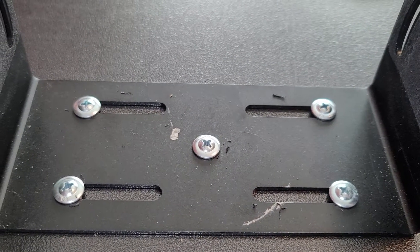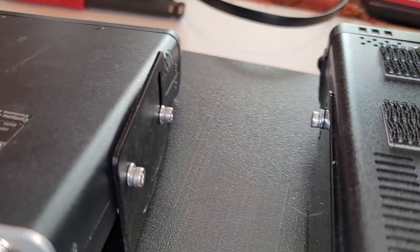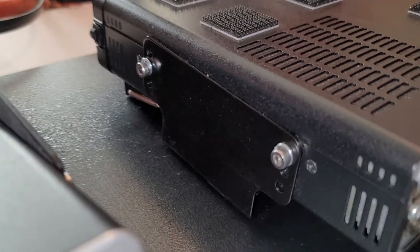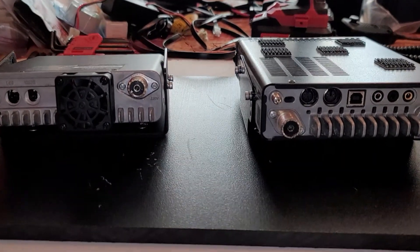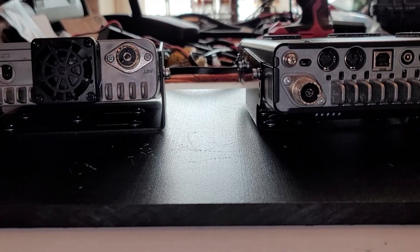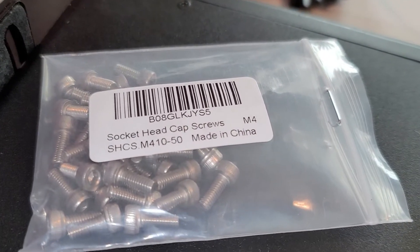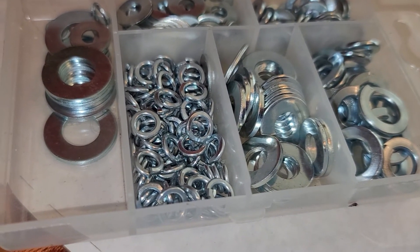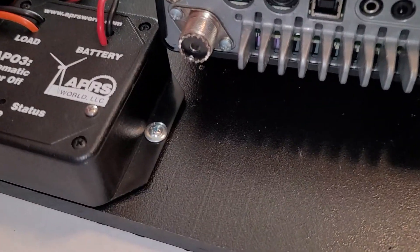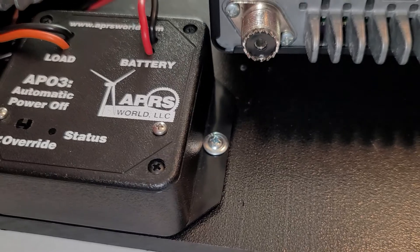I mounted the brackets with five screws each to make a nice heavy-duty mount, since I want to do some light to moderate off-roading and camping. I angled the brackets so they're pointing sort of uphill towards the top — this board is going to be standing vertical in the storage space behind the driver's side rear seat. I also mounted the base units so they're angled up in the bracket, lifting them off the board to make them more visible, since the back end is where you do most of the fiddling. The APO3 is mounted right there next to the ID-5100 base.